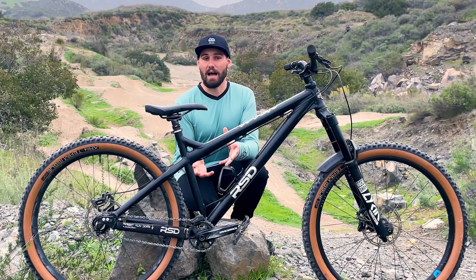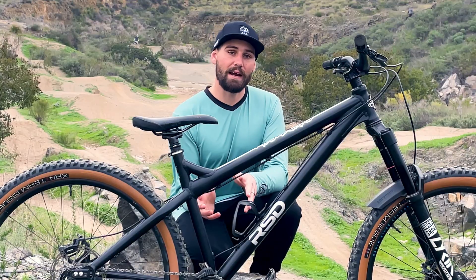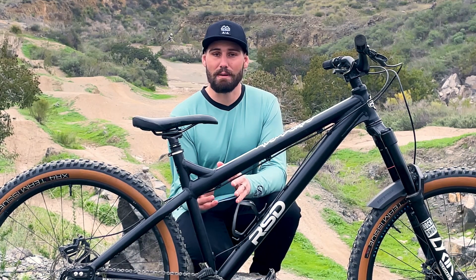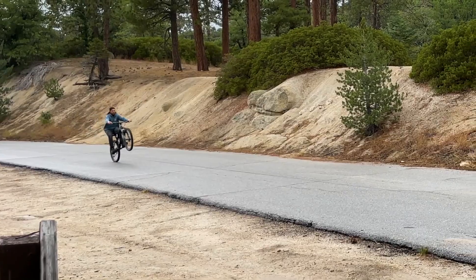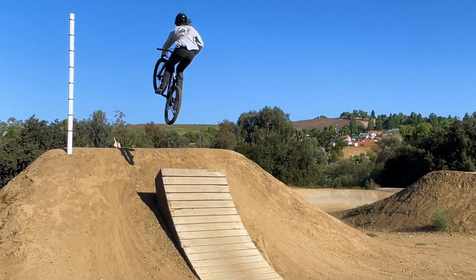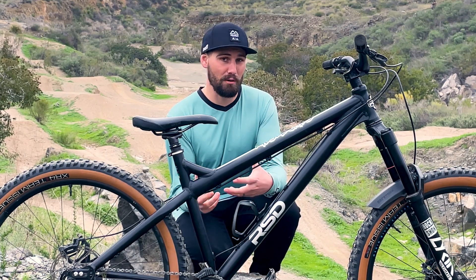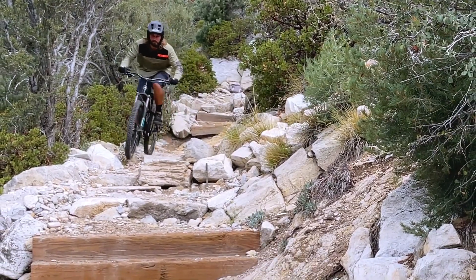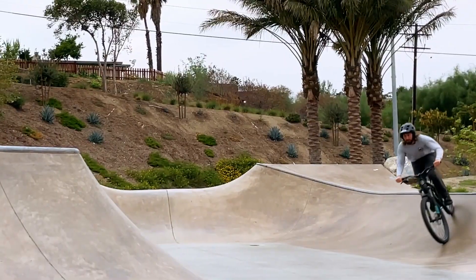It's also got a relatively high bottom bracket with just 40mm of bottom bracket drop. BB drop is probably one of the most underrated geometry figures — most people glance right past it, but it makes just as big a difference in how poppy your bike is and how easy it is to get the front wheel off the ground as a short chainstay does. Finally, it's got a 64.5-degree head tube angle, which I think is just about perfect if you want a bike that's capable on gnarly, chunky, steep trails but also fun on mellower trails or even at a skate park or dirt jump park.